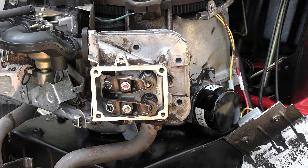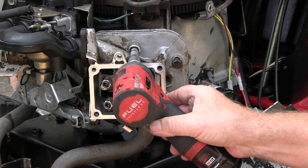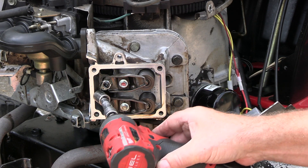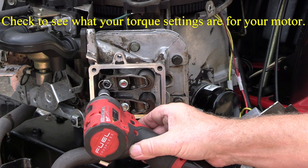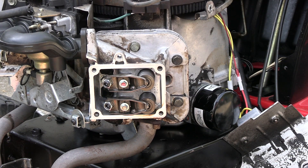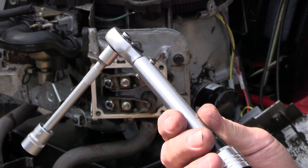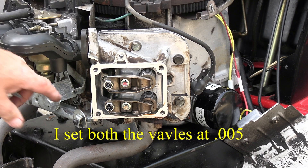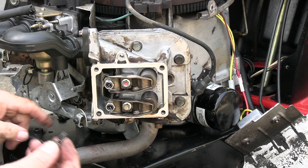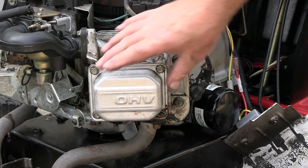We're going to go on just like that. I'm going to get some bolts started. Just go ahead and snug all your bolts now — don't tighten them up because these have to be torqued. Just get them in there holding everything together. Now I'm going to use the torque wrench — I'm going to start with 6, go to 12, and end up at 18. I'm going to put the intake bolts in and my bracket in. Now that I've got the intakes hooked back up, I'm going to go ahead and hook this bracket back up with this one bolt. Now I'll go ahead and put the valve cover on. That's on — it's secure.